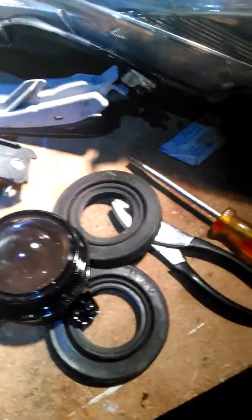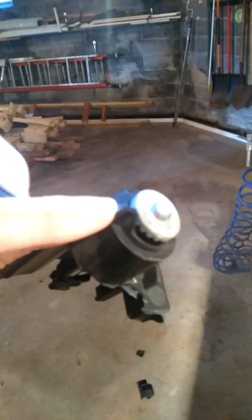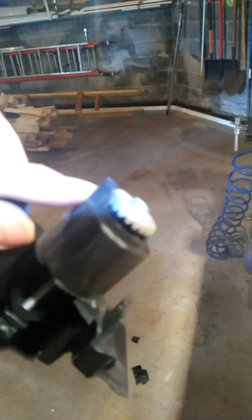So, and another thing while I'm here, the adjustment on this thing, let me see if I can find that. Just so you know, well, I got pieces everywhere. There's the adjuster that you ultimately slide your screwdriver right down in that little slot there. Let me see if I can point to that. I don't have enough hands. You put your Phillips down in there, and it catches on that little stamped, I'm going to call it a wheel gear with teeth, and that raises the whole assembly.